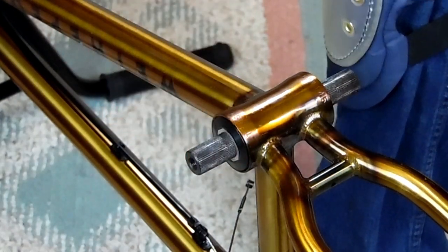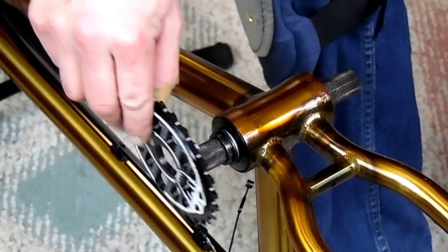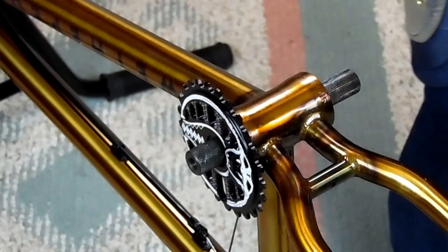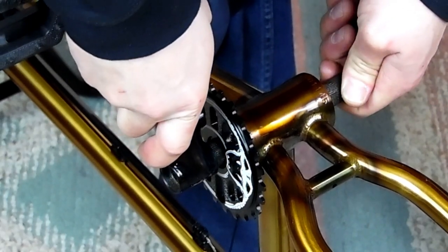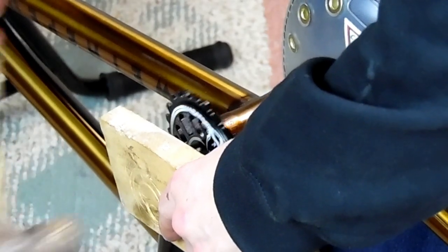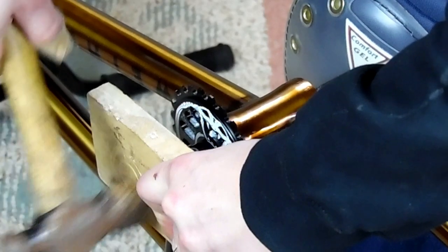After that, we'll put our drive side cone spacer on, and any spacers we established we needed — I'm going to throw one in there on both sides. I've tried bolting the sprocket loosely to the arm before I pounded the arm on, and I don't know — I think they're both just as clumsy either way. It's just going to be a little pounding, a little adjusting, a little pounding, a little adjusting until it's on. That's just how you've got to do it. The best way I've found so far.